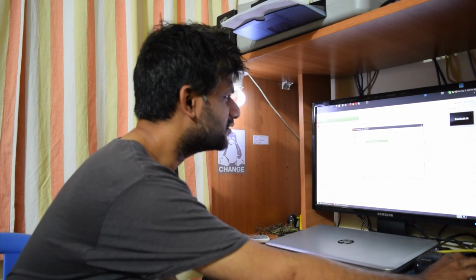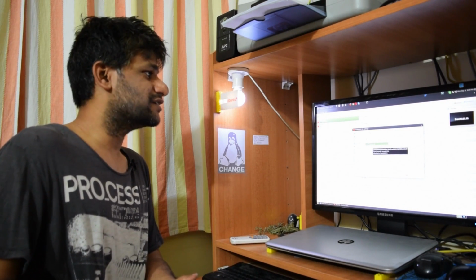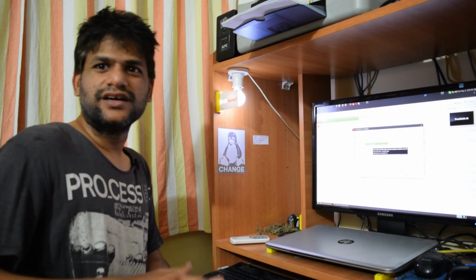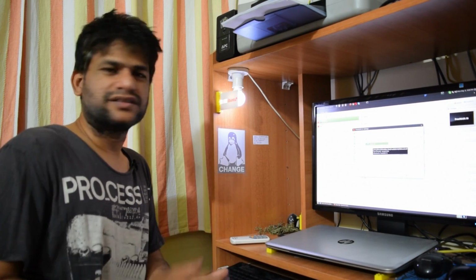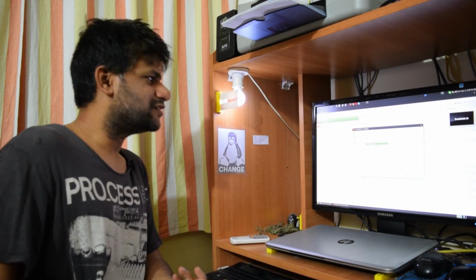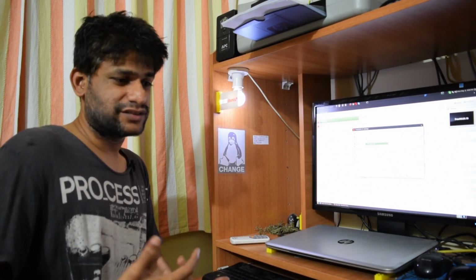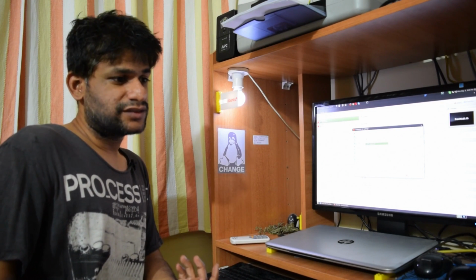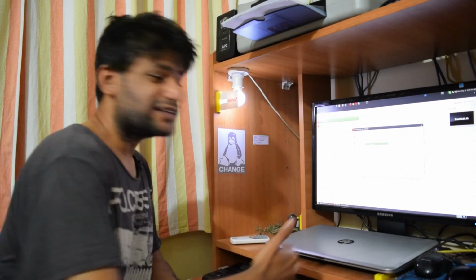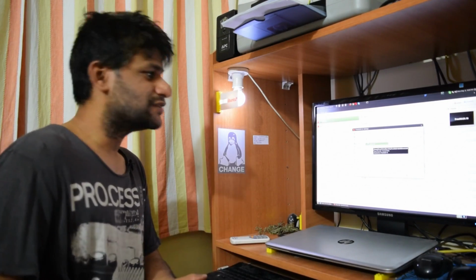Initially I started each drive. The reason it has got this name change is that initially I named these drives HDD1, HDD2, and so on. Then each time, I shut down my FreeNAS system and the VM, deleted the virtual drive, and added another virtual drive, and I included it in the existing ZFS pool, because it says that such and such disk is missing, and then you can just replace it. This way it has been fully reconstructed. You can see each of these virtual drives is around 60 GB.